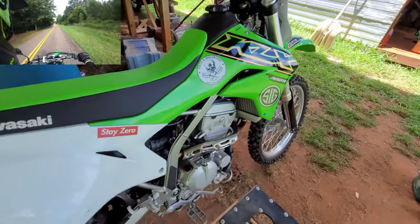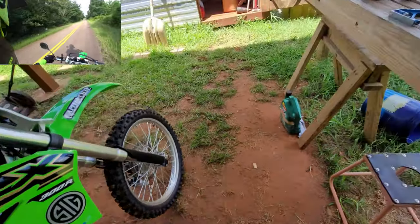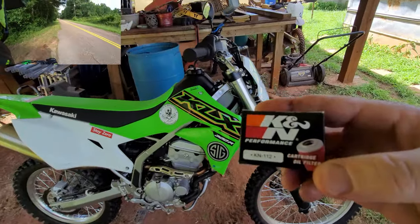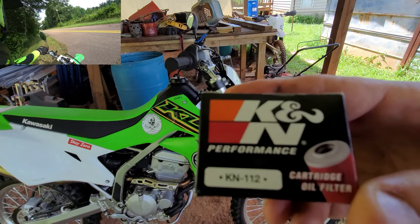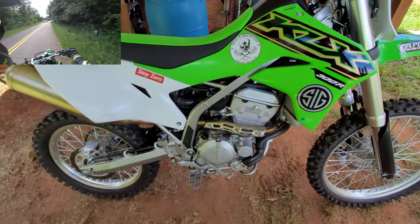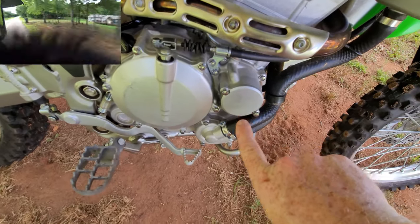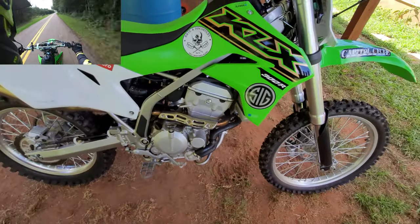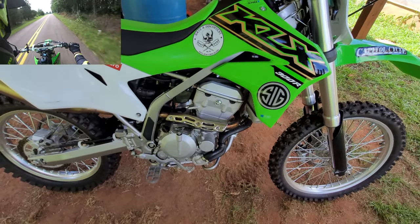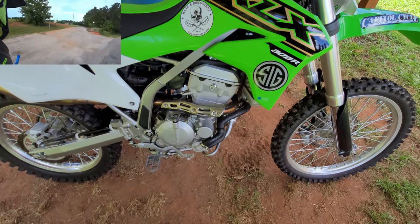The way they designed it, there's an extra 10 cents attached to their filter price, even though I can't even find filters from Kawasaki, they're never in stock, so I bought the K&Ns, which are cheaper. I always buy K&N, right? K&N's my go-to, has been for 25 years. But yeah, there's a spring behind the oil filter to keep the filter where it needs to be with the proper amount of resistance to keep the oil flowing through the little oil reservoir there, and the filler cap reservoir, and oil filter reservoir, and it's a son of a bitch to put in.